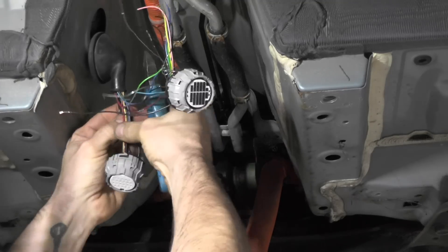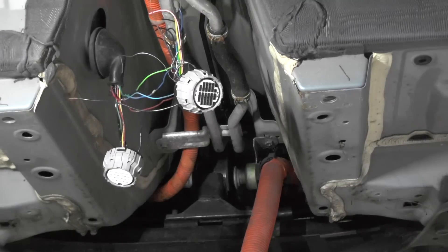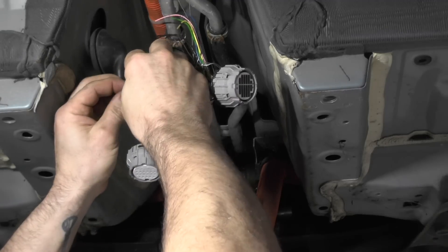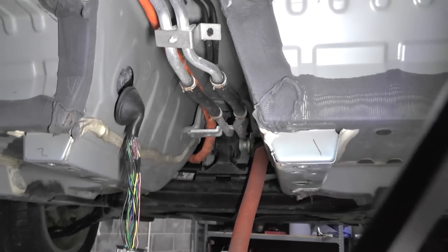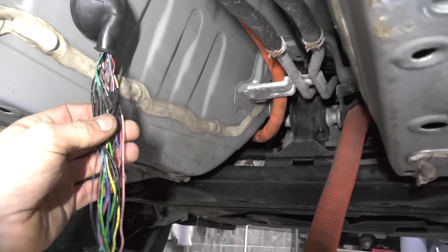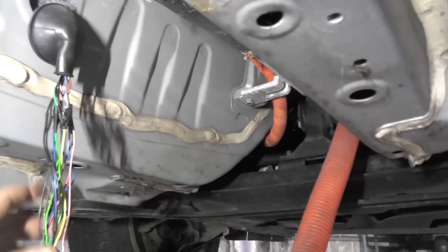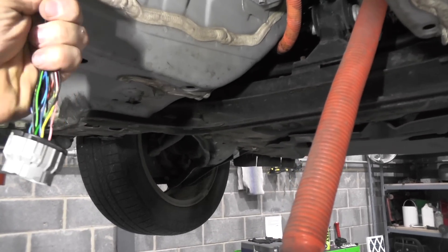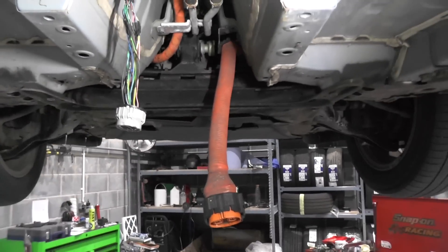Splicing in a new wiring harness is something I didn't want to do twice, so a bit of time taken here is definitely wise. Also, to a degree this is open to the elements, so making sure the joints are well soldered and protected is absolutely essential. I've just spliced this in — it wasn't quite as easy as I first thought, as some of the wires are different colours. It's all heat shrunk and I'm going to wrap it with external wiring loom tape — battery is ready to go back in.